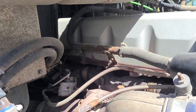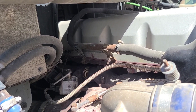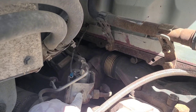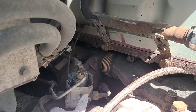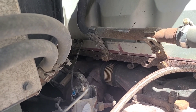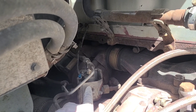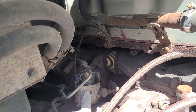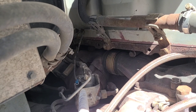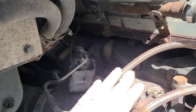So I walked away from the other project. I got the upper bolts loose but the lower ones are giving me a little more of a fight, so I soaked them. Instead of losing my patience and breaking them - which is the typical thing to do - this is what's called a doser valve. Once a year you should pull this off and clean it out. This valve is also referred to as a seventh injector, or hydrocarbon doser is the correct term. What this does: when the truck does a regen while driving or a parked regen, this actually injects fuel into your exhaust right after the turbo. Your exhaust gas temperature comes out of here, and when you go into a regen your ECM will change the timing and do some things to get your exhaust gas temperature up over 900 degrees.